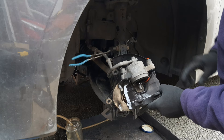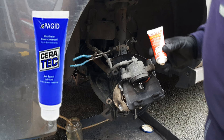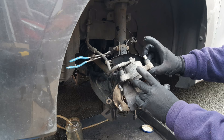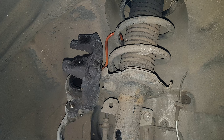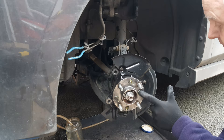Let it dry. Do not use copper grease for this — don't put copper grease anywhere near your brakes. Use some Ceratex from Mintex; there are other suitable products but this is what I choose to use. Squeeze a little into the rubber housing and put your slide pin back in, making sure it runs freely — make sure it turns as well as slides. Just put a tiny smidge of Ceratex on the running surfaces and return your caliper to hang back up on the spring for the time being. Spread a little bit of Ceratex on the mating face for the disc.